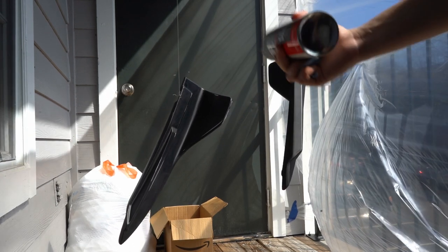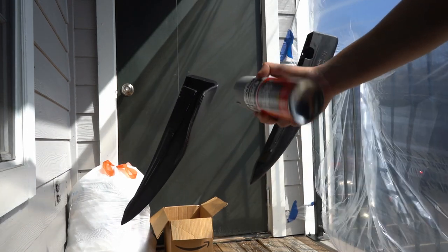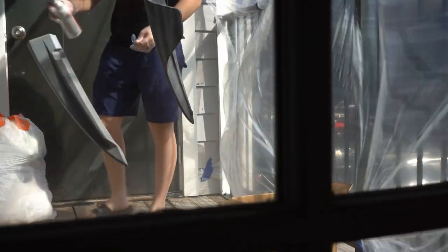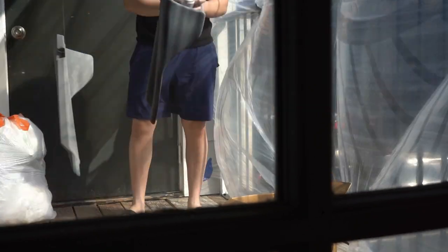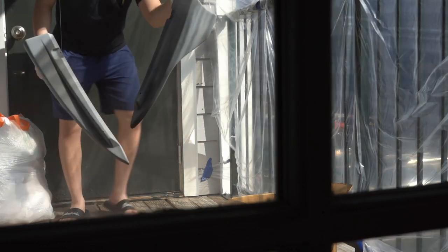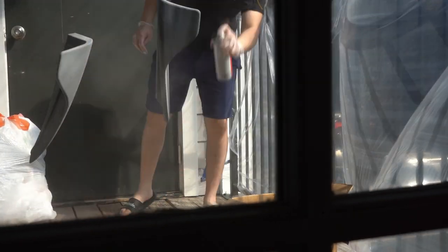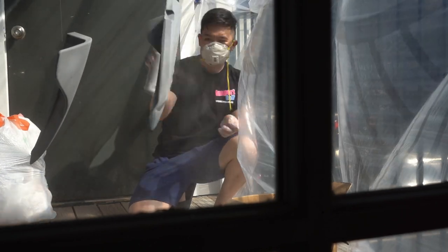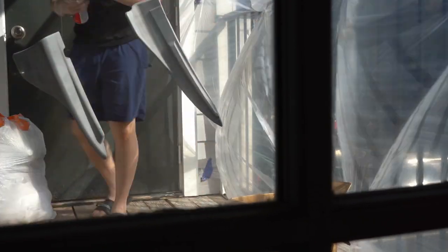I'm using a filler primer from Harbor Freight, doing about three to four coats with ten minutes between each coat. I learned some techniques through Paint Society — huge shout out to them. They do it by quadrants: one part, then the second, then the third, then hit it all at once. The first coat I go all the way across, the second coat I do the quadrant split into three parts, and the third coat I go all the way across again. That way it makes for even coverage.